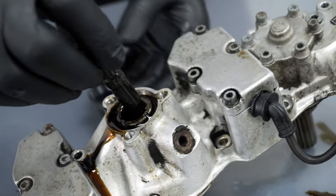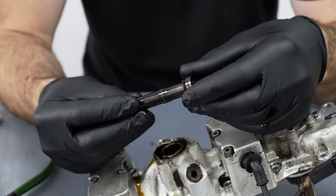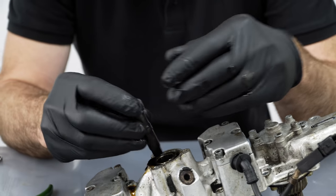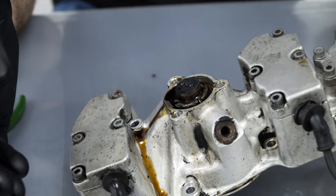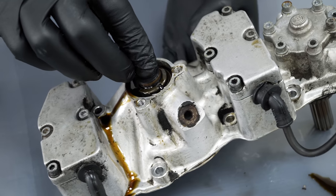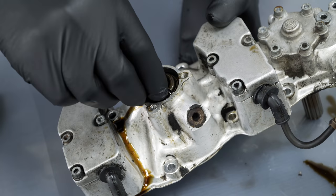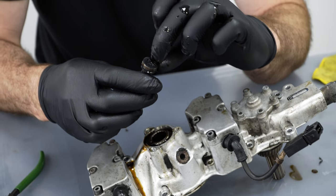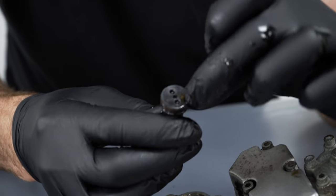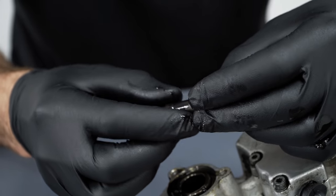Here is the piston from the exhaust side of the unit. That slots into this bore, and that essentially is what oil pressure runs on the back side and the fore side, and basically fires the spline in and out of the unit. A common thing we find with these is the top half of that's smashed across there, which obviously loses pressure when it doesn't function properly.